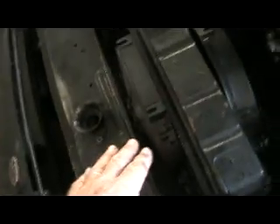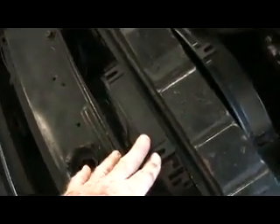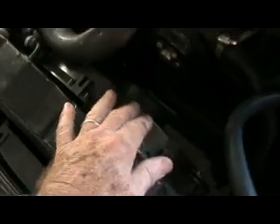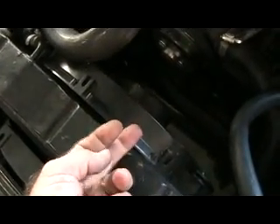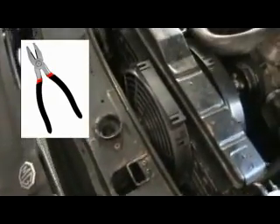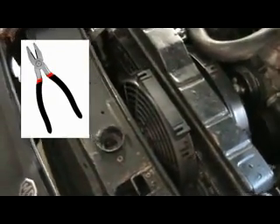The hard part is you've got to put the little fan on first. If you're going to use those plastic stems that go through with a little connector on them, because this is a smaller diameter, you have to put it on and clip off the excess rod sticking through so it doesn't interfere with the second fan. The second fan goes on — the clips are outboard of the first one and much more accessible from the front to be easily clipped. How do you clip them? You use a pair of dykes or those pliers that come in your electrical kit.